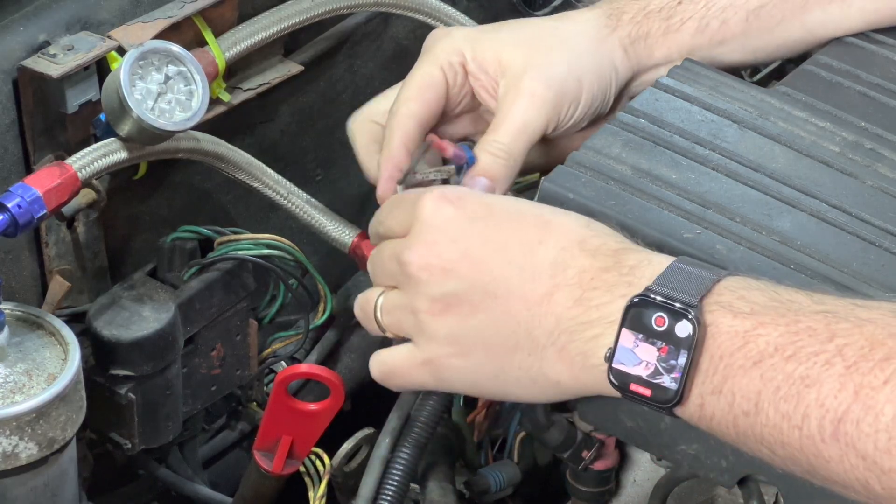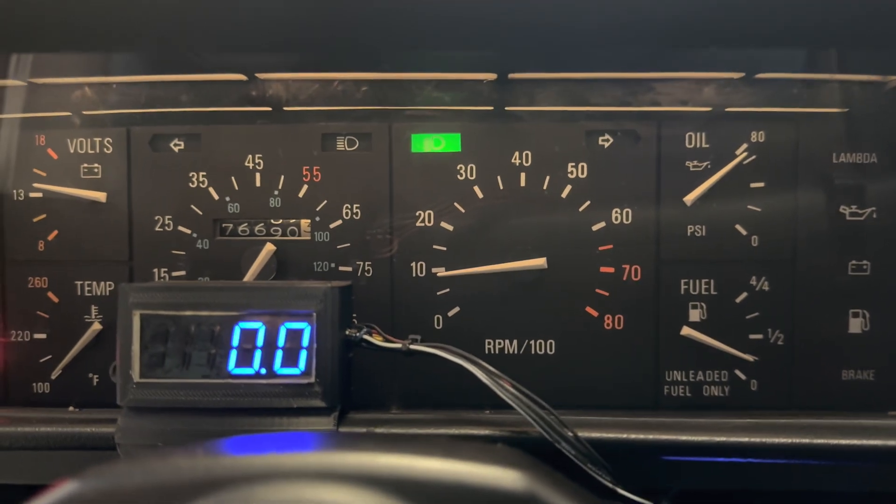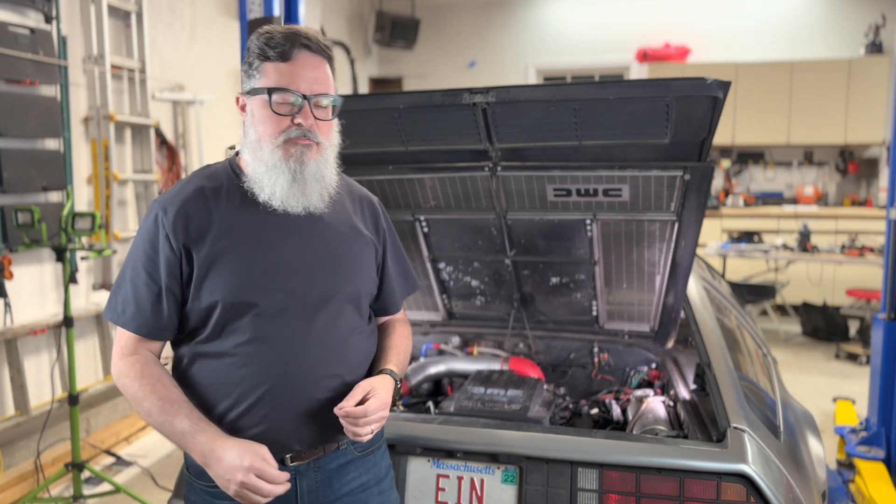So I fixed the loose wire. Now the car idles properly again. The oxygen sensor was completely unrelated, but now that I've replaced it, the car should run more efficiently and have a little more power. I really should figure out how to get a throttle position sensor that actually works sometime, but that's a project for the future. At least now I can drive my car and not worry about it stalling — well, not from this anyway.